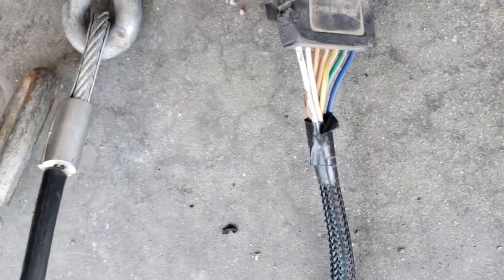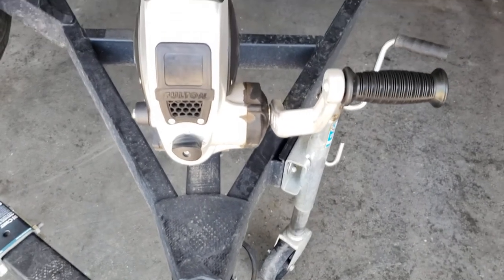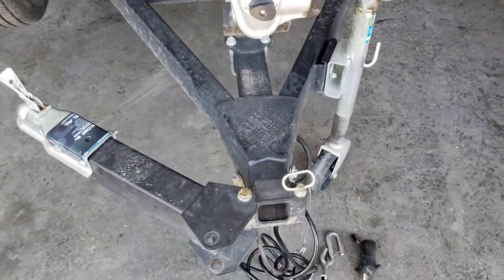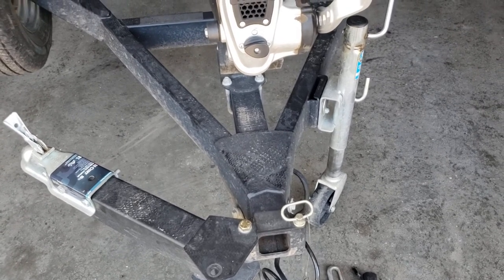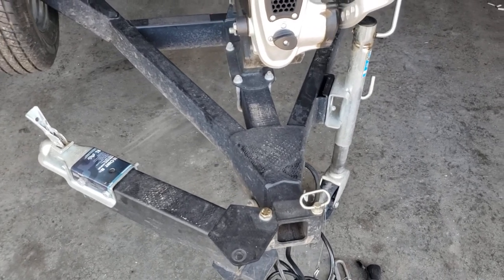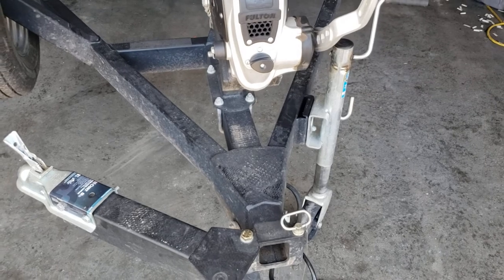See my wiring harness there — it's got six wires going to it instead of the four or five that most of you might be familiar with. The reason for that is my trailer has reverse lights. I didn't realize how big a deal that was — this is my first boat with them. Comparing it to buddies' trailers, those reverse lights make a tremendous difference. When retrieving at night you can see where the back end of the trailer is a lot easier when it's lit up — lights up the launch white instead of just red.